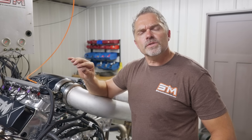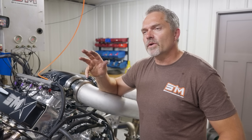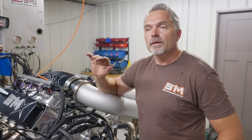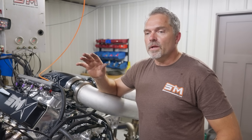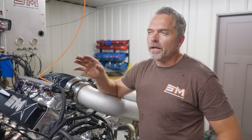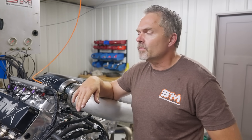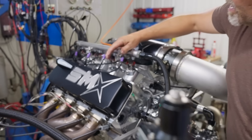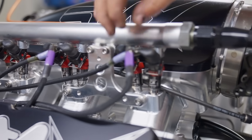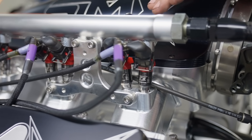Non-intercooled E85. I'm not 100% sure if he's going to run it on an intercooler or not. And if we can get time, I might try to do this on methanol also. But I've already been running it some and having a couple little struggles with dyno control and how the great big single like this is operating compared to dyno. You can see FuelTech SMX, fully water jacketed. These are the high-impedance FuelTech injectors, and these are quite nice, actually.